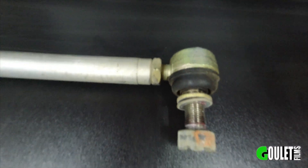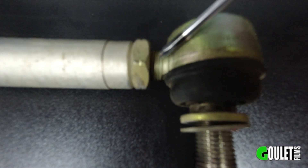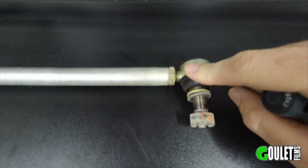The point I'm trying to make is this is a normal nut here. If you go to this end and you're trying to remove these, see these little notches? There's little notches in the nut — that means this is a left-hand thread, so you actually have to spin this the opposite way that you normally would to remove something.